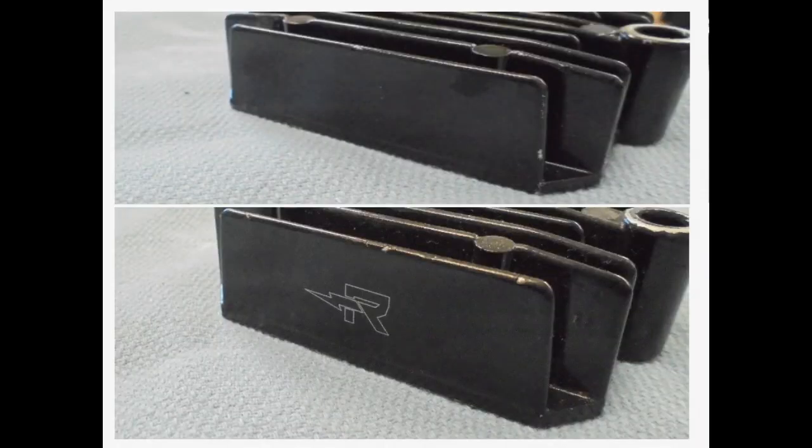So the 14 prefix is lithium and the 10 prefix is lead acid. If I already have a Rick's rec reg installed on my bike, is there any way I can tell if it's a lithium ion or a lead acid? If you look at the bottom of the rectifier regulator, the lithium ion rec regs will have an R logo — basically our company logo on the bottom — and the stock ones will not.